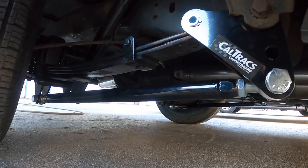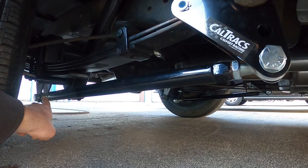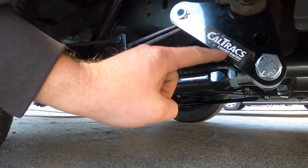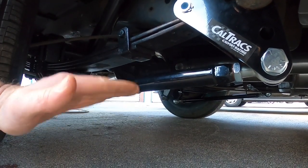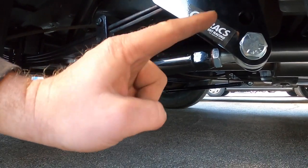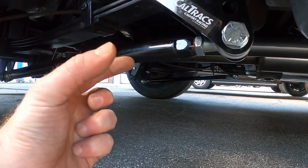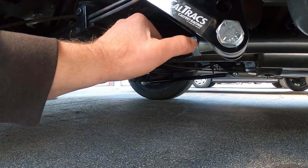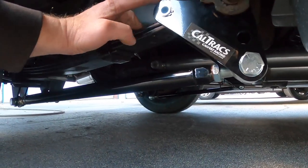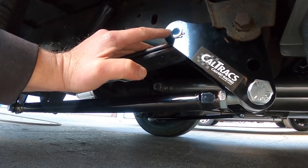All right. So, you have the pivot bar, right? You have the link rod. And back there is the back bracket on the bottom of the U-bolts. What you do is, with it on the ground, weight on the tires, you make it where either this bolt or that bolt, I did this one because it's easier to get to, has zero resistance. They can just slide in and out of the hole in relation to the Heim joints. These jam nuts will be loose and slide in and out with this pin resting on top of the leaf spring, right? And they call that zero preload.